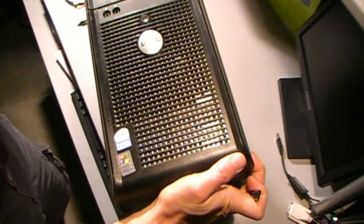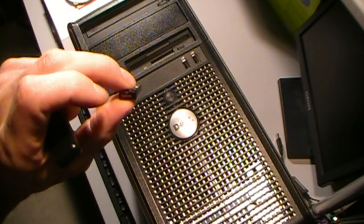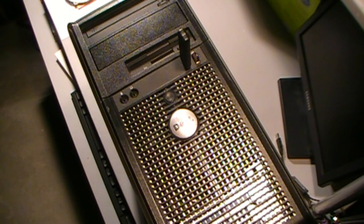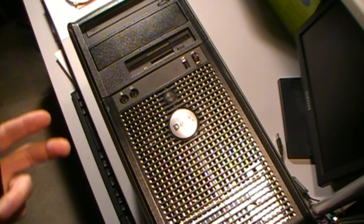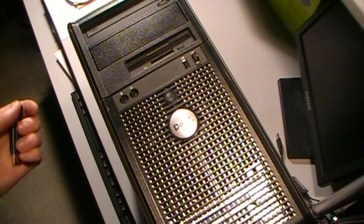This NAS box is just about ready to install. The reason I use these little flash drives for FreeNAS is they're very small and inconspicuous — it's plenty of space to install the operating system even though 4 gigs is nothing these days. Using a larger device is tempting, but if it's in the corner by the company's server or in the closet, it's very easy to bump it, break it, or have somebody grab it thinking it's a spare flash drive, and there goes your file system, your backup, or whatever you're running on the NAS box. So I use the little small SanDisk ones — they're kind of difficult to pull and remove, they don't look like anything important, they're just sitting there doing their job. You can also install them in the back if you need to press into a tight space.